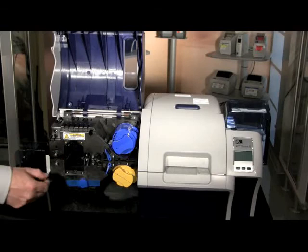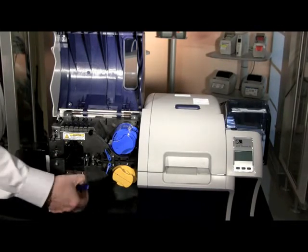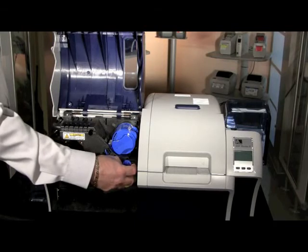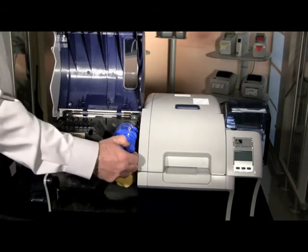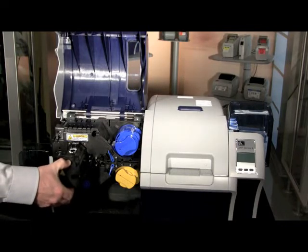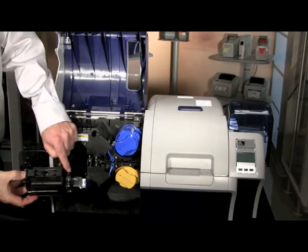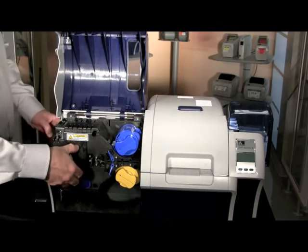To be able to move your card through this station, there is a tool on the front. If you haven't already removed the tape when you first got your printer, remove the tape and twist the tool to remove it from the printer. It has slots to act as a screwdriver to engage on the rollers and help churn them to move the card. Be careful — many of these rollers will only move in the direction of the exit; do not move it back toward the printer as you can cause damage. Once you've cleared the card jam, slide the heated roller assembly back into the printer. If you hit resistance and see a visible gap, realign the gears on the back of the heated cassette assembly to match with the printer until the cartridge slides completely into place. Then reinstall the four thumb screws and resume printing.